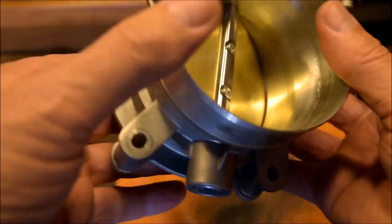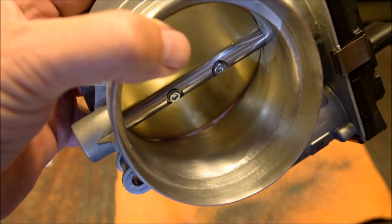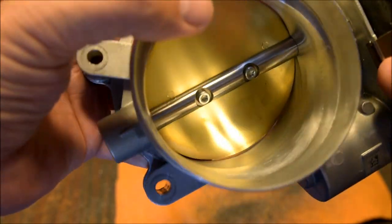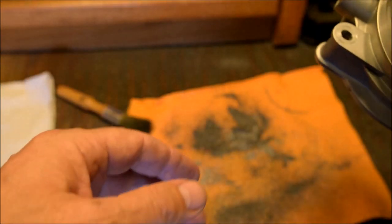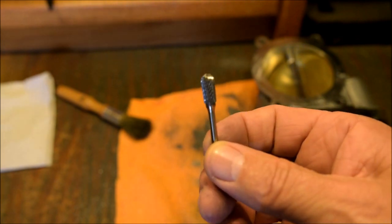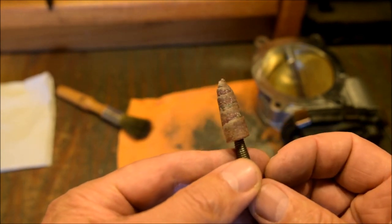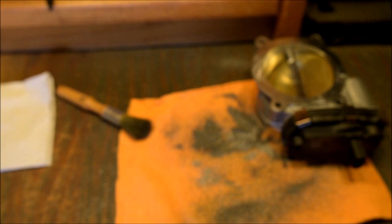I'm going to bolt it back in. If you do this, make sure you get every speck of metal out of there — I've got my little brush here and I'm going to blow this out too, to make sure there's not a single little speck of metal getting sucked back into the motor. For tools: use the carbide burr first — it takes out a lot of material quickly. Then I switch to the cartridge roll, which is just sandpaper, a spiral. It doesn't remove material as quickly as the carbide burr.